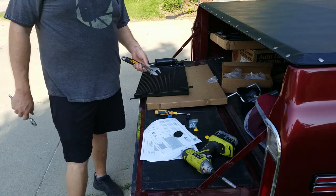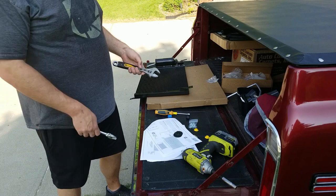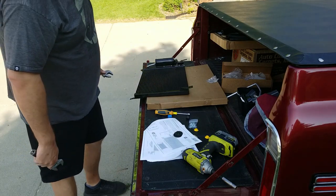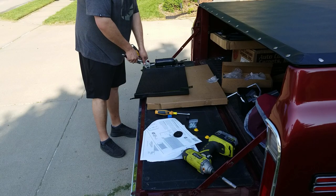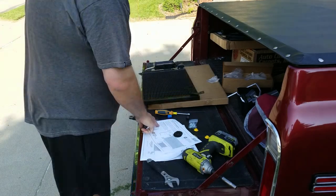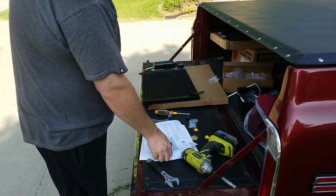Now, since this is supposed to be done with a certified AC technician, not a certified automotive technician, we get to use the Swedish nut lathe. Because that's how a certified AC technician would take care of this problem. Screw the high pressure switch into the port on the top of the dryer and plug in the harness.